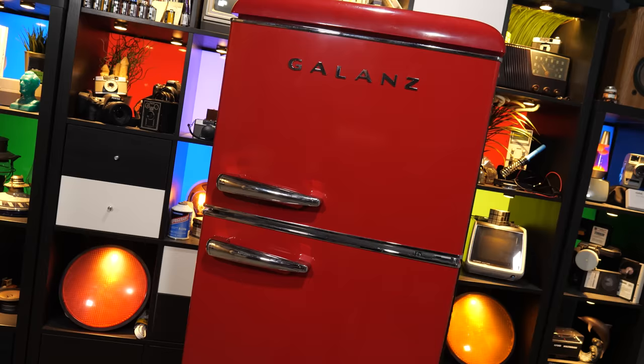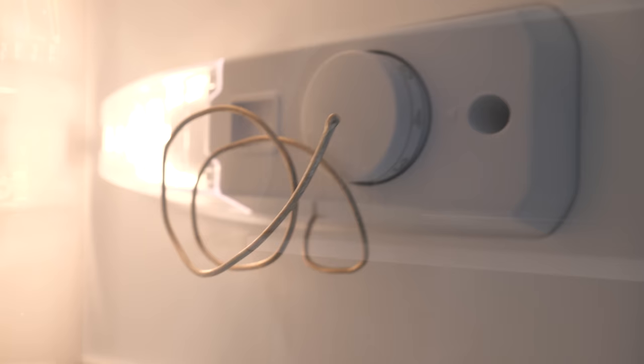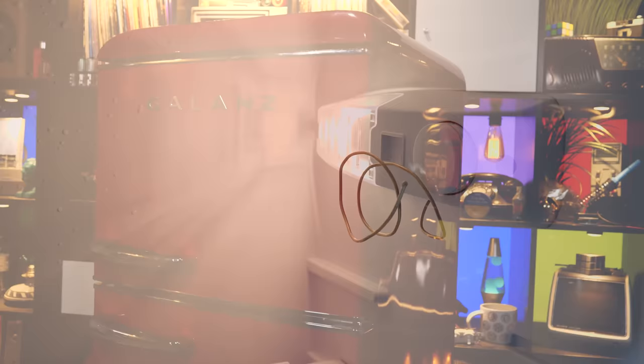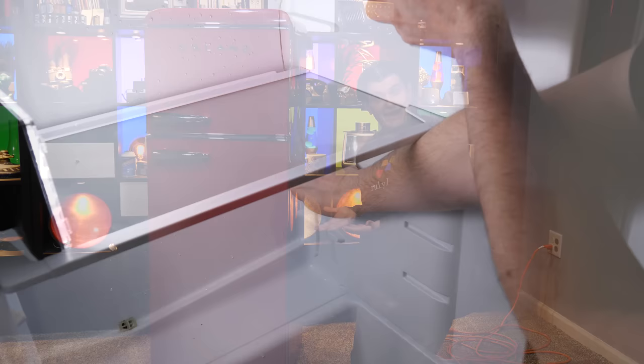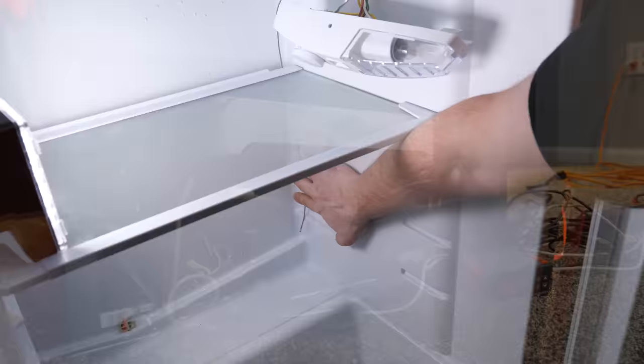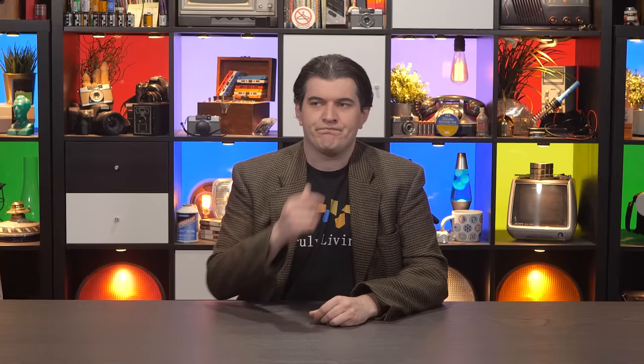Yes, it's still not great at chilling large quantities of stuff, and the freezer has its own peculiarities in addition to requiring the occasional defrosting. But so long as you remember its limitations and are okay with them, this fridge was mainly let down by a bad thermostat. It makes me wonder if perhaps they had just gone that extra step to an electronic controller and a well-placed sensor, they would still be offering this model — it was really quite inexpensive for such a large fridge. Still, while I've made it miles better than it originally was, there's still room for improvement. The designers may have been correct to put the sensing bulb towards the bottom of the fridge compartment. It's apparently warmer down there on average, which honestly surprises me. Warm air rises, after all, but I guess enough warmth from the compressor infiltrates through the bottom, which would also explain why the crisper drawer consistently stays just a little too warm.